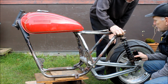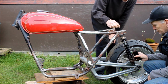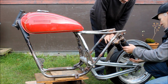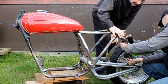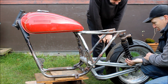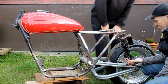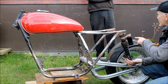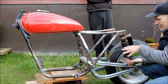That would be great. A device where we can just wind them and gently ease them out, and then make a little tool to do it. In actual fact, I think they're supposed to go that way. The piggyback. So the height's not quite right yet, because that's 12, and that's a little bit too low at the moment. Well, you can do it either way. It doesn't matter, some up the bottom and some at the top. The idea is that by putting it at the top, you reduce unsprung mass, because the bottom bit is obviously moving down. So that's kind of the look we're going to go for.